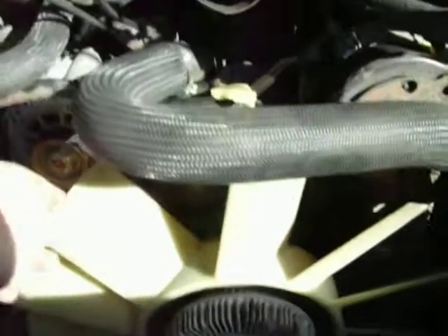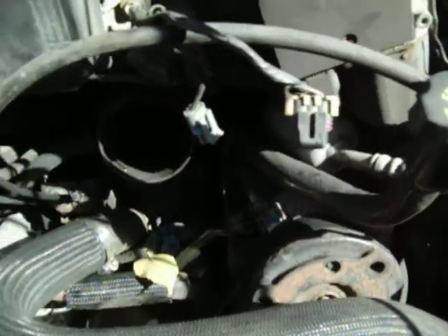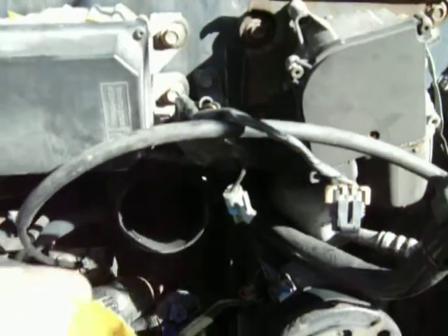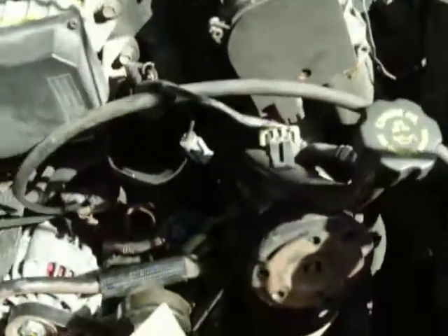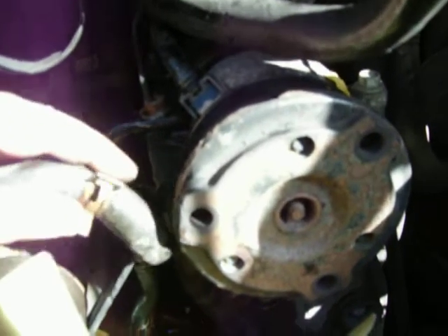The upper radiator shroud is out. The fan has a gap with a slightly larger opening than the rest of the blades — I usually orient that gap to get my big paws through. Next, remove the upper radiator hose and place that aside. Then reach through the gap in the fan, loosen the clamp, and pry the water pump hose up and out of the way so it won't interfere with your procedure.